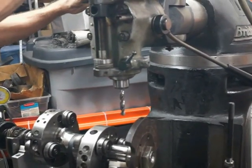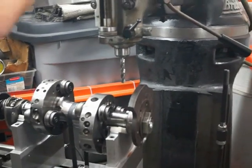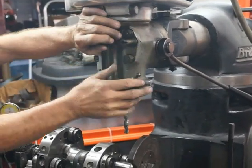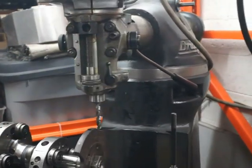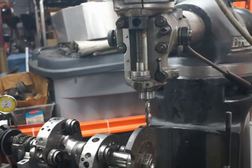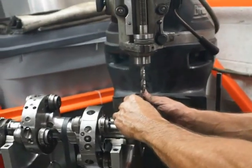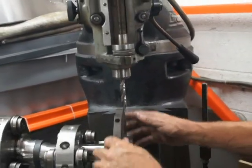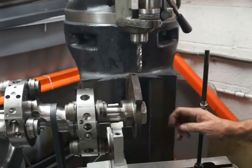Big advantage of having a quality drill mill like a Bridgeport is the flexibility of being able to shift the head anywhere you want it. And it's funny, but that's exactly where Mazda had drilled it. Exactly where the machine says it's heavy, that's exactly where Mazda drilled it. Notice that there's no other mark, right, when they did it from factory. So they're pretty close, they're pretty good.